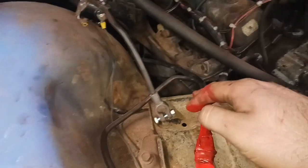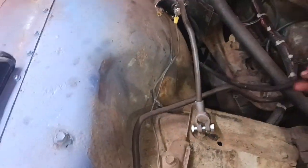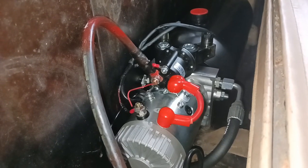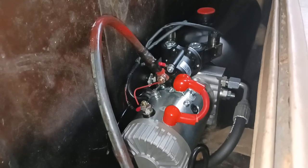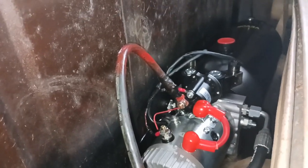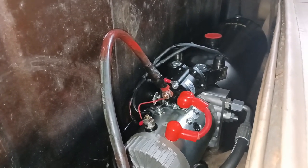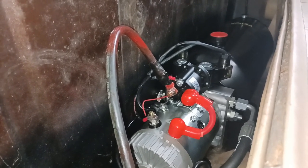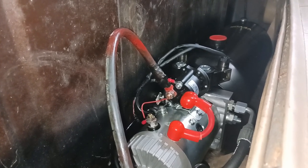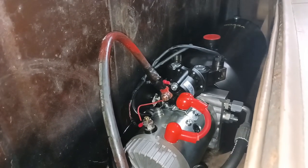We're going to route it right here against the firewall and go ahead and hook it to our positive battery terminal — I painted that red so I know that's the positive one. There's our positive connection, painted, taped up, and connected. Now we're going to start on the negative side, which is going to be our switch side. I'm weird — I like switching on the ground. I personally think it's better. People argue about that, especially on a situation where you're running power into the cab anyway. I prefer to run the ground. We're going to make up our next cable end, then we're going to be kind of at a standstill until our switch plate gets done drying.